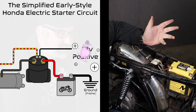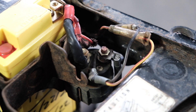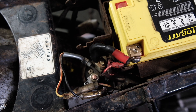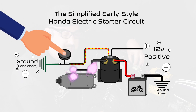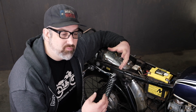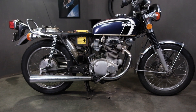The other part of the solenoid connects the battery to the electric starter. That first part of the circuit just triggers the solenoid into action — because a solenoid is a switch that's triggered by a switch, it's a stepper switch. The electric starter is the one electrical component on the entire bike that uses a lot of battery power and draws a lot of current. So the reason we have a solenoid is so it's its own big switch, which a lot of current can pass through to turn the starter. The solenoid triggers and connects the battery directly to the starter — so you have to check both that the solenoid triggers and that current passes through the larger connections.